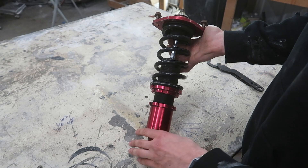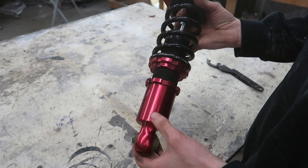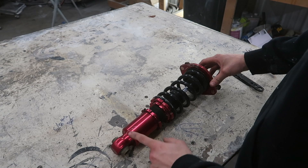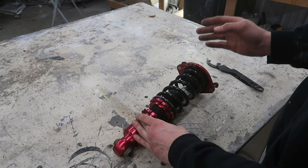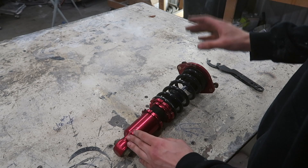The first way to go as low as possible is to screw the shock body into the cup as far as possible. That's how the factory recommends you get the car as low as possible, but once you run into the bottom with the shock body you're going to run into issues if you want to go lower. Once the shock body is completely bottomed out into the rear cup, I'll use the preload adjustment to lower the car further. The spring will be a little loose — with a jump on the car or some driving it'll snap back into place. It's not ideal, but if you're trying to go lower this is kind of the only way.